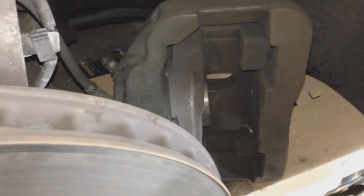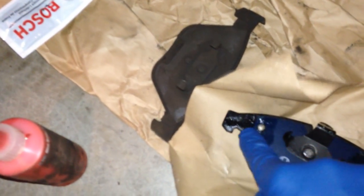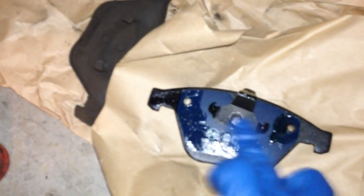With BMWs — this is my first time doing this — there's only one large piston, unlike my Cadillac CTS which had two piston compressions. I just cleaned that one. Now I'm going to apply the silicone grease that came with the kit to anything metal-on-metal that will rub. Flip the brake pad over and apply it around the base. Don't get it on the actual ceramic or organic pad surface itself — just anywhere metal touches metal to prevent any type of noise.